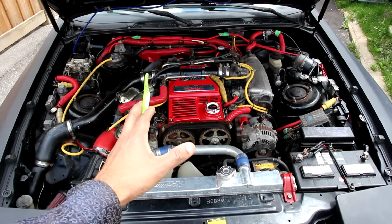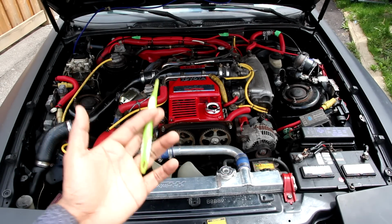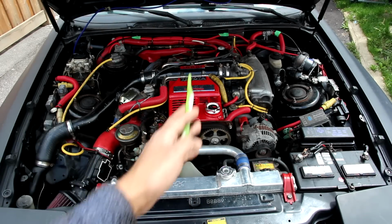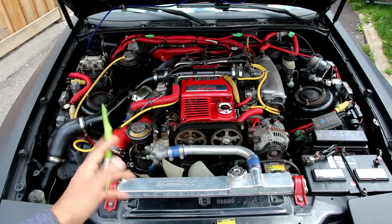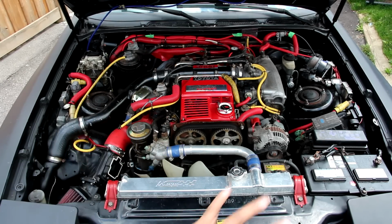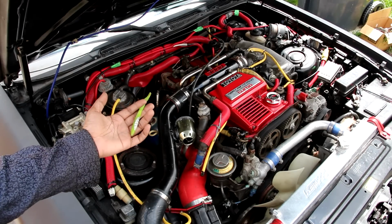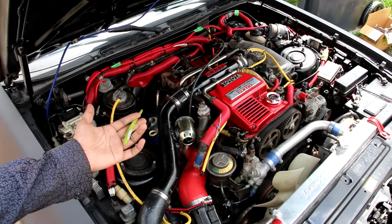And we're going to start underneath the hood where we have the Toyota 7M-GTE 3-liter inline 6 turbocharged engine, and it's situated right in the middle longitudinally for rear wheel drive. Now you'll notice that there's quite a lot of room under the hood of this Supra, and that's because an inline 6-cylinder engine is a pretty long engine to fit, but this is also 1987 where everything is really well laid out and accessible. Now out of the factory, this engine made about 231 horsepower and 240 pound-feet of torque, which was a lot for its time.